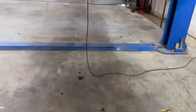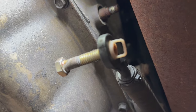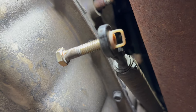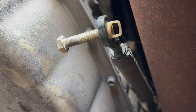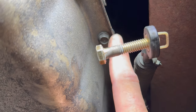I'm sick and tired of this bushing. I'm never going to trust it again after it failed with a new bushing. You can see that the 5/16ths fits in until it reaches the part that's supposed to retain it on the stud. I'm just going to take a razor blade and file that off, so there'll still be nylon in there so the actual cable doesn't wear. Without it being press-fit retained, I think it'll be just fine resting on the shouldered piece. I want to get that ground out, put this in place, and check my clearance against the trans pan lip.